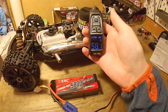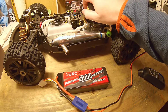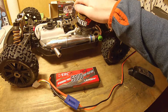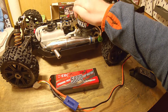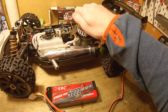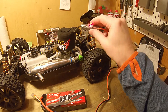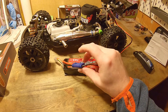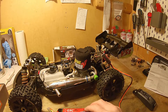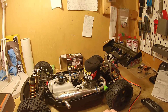Temperature is 58.1 degrees. It's going slower now because I don't believe the heater is going any higher in temperature — it just takes time to transfer the heat to the engine block. There's a lot of metal there. Also, it says you should not start the engine with the heater on, so you at least have to stop it and disconnect the battery plug, then try to start it. You could keep the heater on the cooling block just to not let it cool too fast, or wrap something on the cooler block.